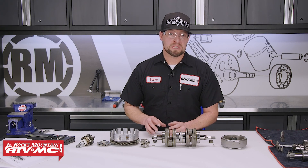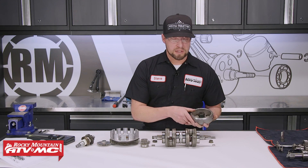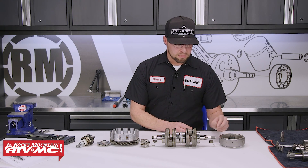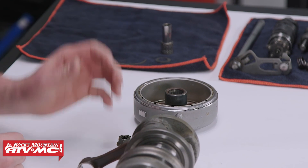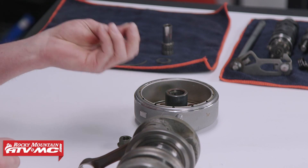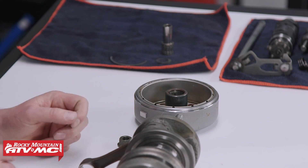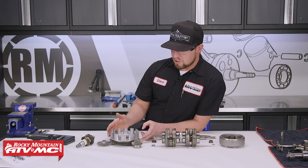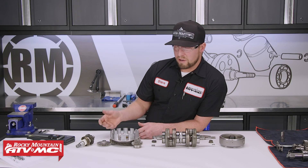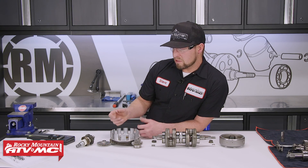Now I've got the last few components to inspect besides the crankshaft. We'll start with the flywheel — there's not much that can go wrong here other than it coming apart, so just make sure it's solid. The important part about the flywheel is its attachment to the crankshaft via a nut and keyway — inspect the keyway, as these can shear off. On this side we have the primary gear, clutch basket gear, idler gear, and kickstart spindle. What these all have in common is they work together meshed by teeth, so inspect those teeth for cracks, chips, and excessive free play.